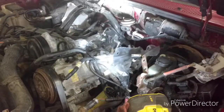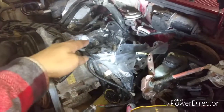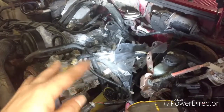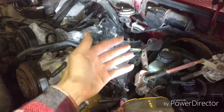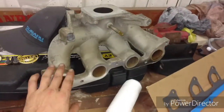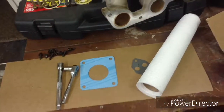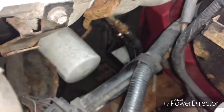I went over everything and covered it with plastic. With the intake manifold and valve cover taken off, I went inside and along the top edge where the new gasket mates — I cleaned it up with brake cleaner on a rag, then went through with the air gun and blew all the ports out. I brake cleaned everything, got all the oil out of the ports, and now it's basically ready for the new gasket.